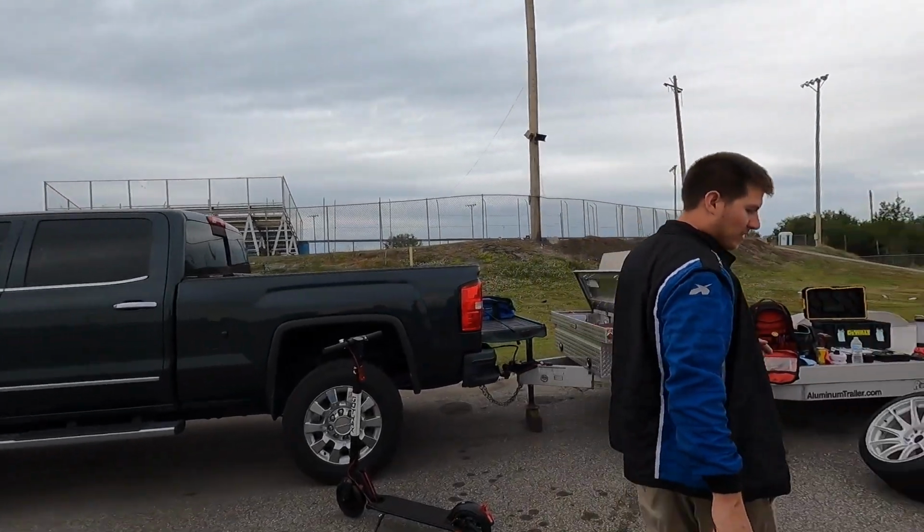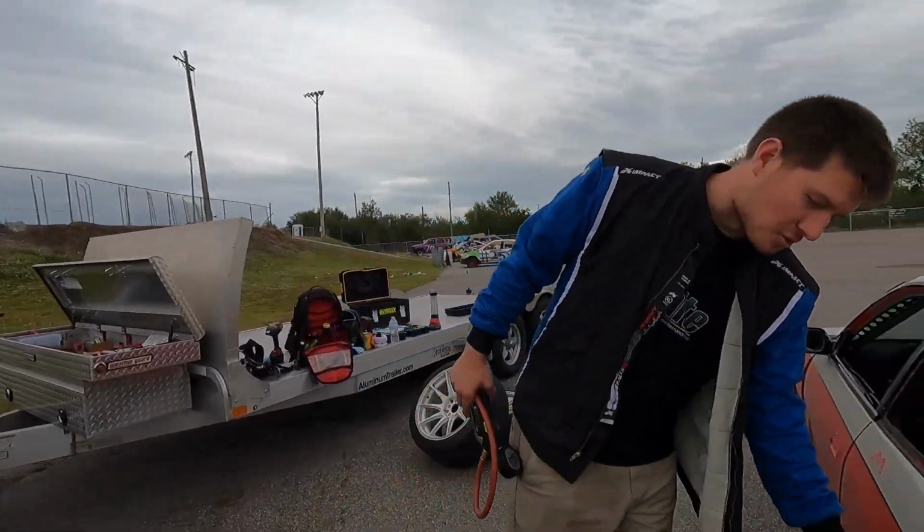That's kind of the thing with drifting. You have to play around with tires to see what your car really likes, how much grip you want, and the surface takes into account there. So I don't know, maybe we won't run those 265s most of the time. Maybe I'll get a 245 for the back or a 235 or something a little smaller. I don't know, play around with it, but these fit a little better. They kind of are stretched onto it.